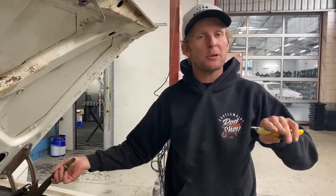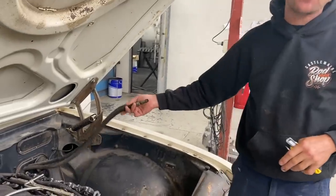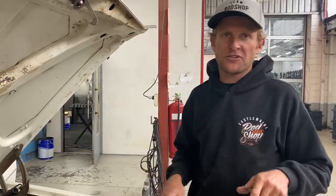We're going to bang the heater hoses on now and replace them all the way to the heater box. I've never been under that dash since this car was built. I'll jump underneath, undo the hose clamp, slice down the side of the hose where it's on the fitting, and gently slide it off — showing you how to safely remove it without damaging your heater box. You do not want to wrench on the hose too hard on the heater box, it'll be a little bit frail.